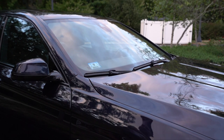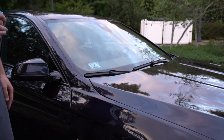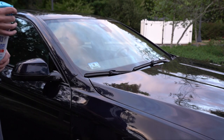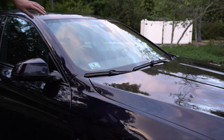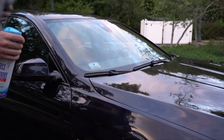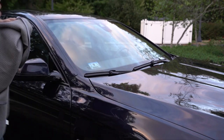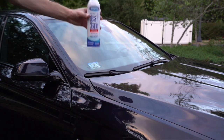One of the final steps is to wash the glass. One thing I forgot to mention - I do usually lift the wiper blades up and get the wash mitt under them. On this BMW F10 there's a special mode where you go to key position one and click the wiper down once and it brings them up. We're going to spray the glass cleaner and use a waffle weave towel - you must have a waffle weave towel to leave no streaks. That's my recipe for perfectly streak-free glass every time.